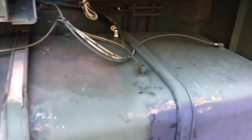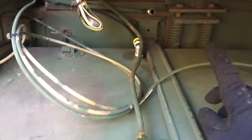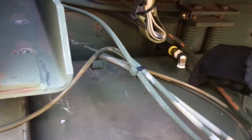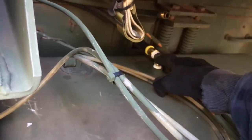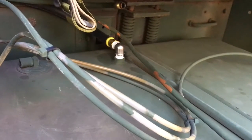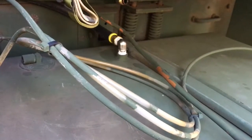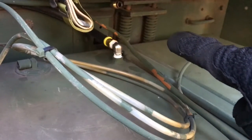We are back and believe it or not, everything is done. We left off with disconnecting the feed line from the tank. This is where mine differs from other videos — I'm changing out the actual draw tube that goes into the tank. If you're going to put in the tube Ted makes, it's a pain. First of all, you have to pull your tank out. I could not get the old one out without cutting it with bolt cutters and pulling it out. There was no way to fit the new one in with the tank in its position.